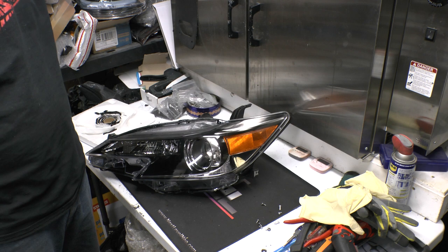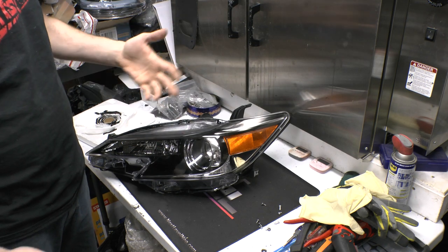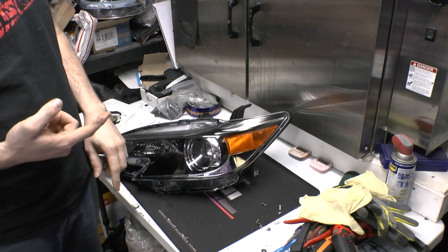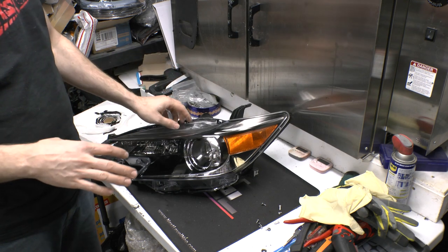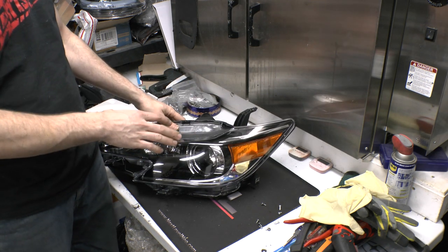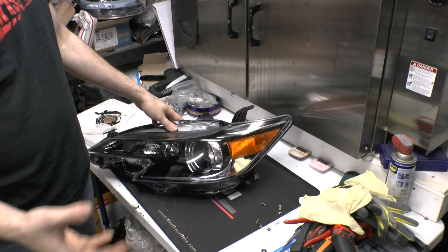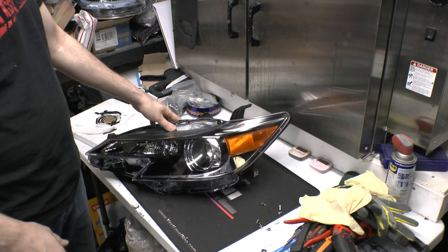Charger headlights used to be pretty easy to open but the last set I got was a nightmare. Some brands can change what permaseal they're actually using. A lot of the new Subaru lights the permaseal is a nightmare — it can be opened but you're going to really mangle your light up a good bit. Take these as techniques more than anything, but don't expect to have the same experience on every permaseal light. I'm going to show you the tricks I use and hopefully it works for the set you're building, but be prepared that it may not.